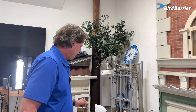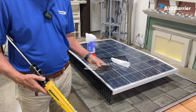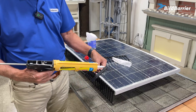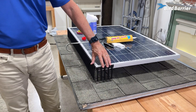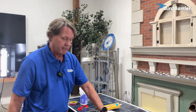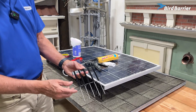The last way that you can apply these to the panel is with Bird Barrier Bond. I'd wipe it down with the alcohol on the part and on the surface, and then just apply it. Essentially a small bead of glue along here — Bird Barrier Bond — press it in place, and it's going to hold in place. If you're worried about it falling down, you might apply a piece of tape on it to hold it in place while the glue dries. You'd be able to take that tape off within an hour or so, and the product would be nice and secured long term. The glue would also come up through the screw holes, which would be a nice extra mechanical grip.